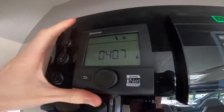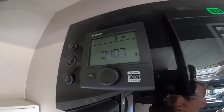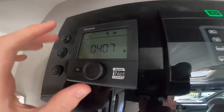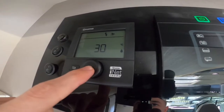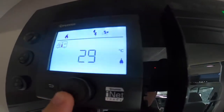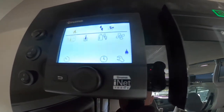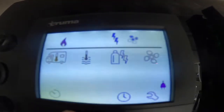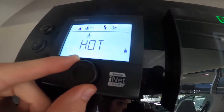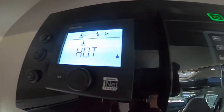Next to it is your Truma C control panel. On the Chasson models your fuel sources are electric and diesel — they do not use gas for the heating or hot water system. From a blank screen, press and hold the wheel to turn it on. You'll get this screen — press enter. The van with the thermometer icon is the vehicle temperature; you can set it anywhere from off to 30 degrees. Press enter to save. The thermometer with water is your hot water setting — off, eco (50 degrees), hot (70 degrees), or boost which turns heating off and prioritises the water.